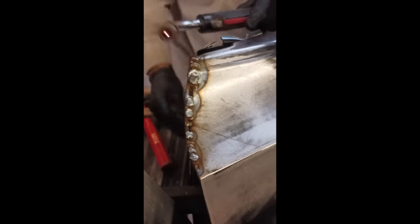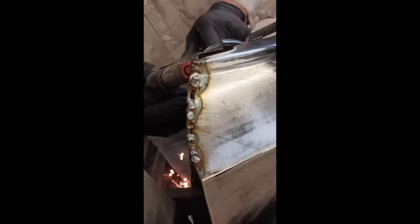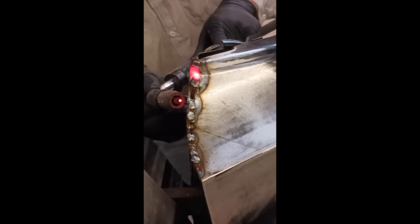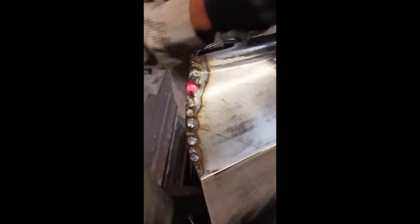If you take your time, be patient, follow all the steps, you don't have to end up with a bunch of filler. There's nothing wrong with a little bit of body filler, but it's so easily avoided by just doing it correctly with a little forethought. You'll notice I'm welding the backside also. What you're not seeing in the video is I'm kind of pausing in between, not wanting to let it get too hot. There's not really going to be a problem with warping here because it's curved and right on an edge, but it's just best practice not to get in the habit of welding too quickly.